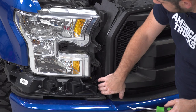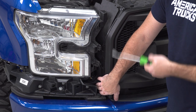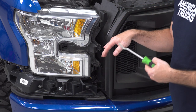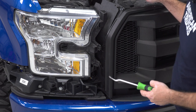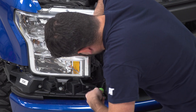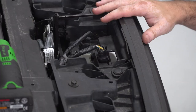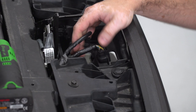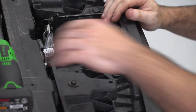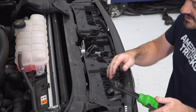There is an 8-millimeter screw located on the bottom corner of each side of the grille. Remove that with an 8-millimeter socket, then move up the sides of the grille where there are three plastic clips that hold the flexible air dam to the side of the grille. I'm using my clip removal tool to pop these clips out on both sides. Moving back up to the top of the grille, there are two electrical connections to remove — one for the active shutter and one for the ambient air temperature sensor. Unplug those and set the connectors aside, then use your 10-millimeter socket to remove the four 10-millimeter headed bolts retaining the top of the grille.